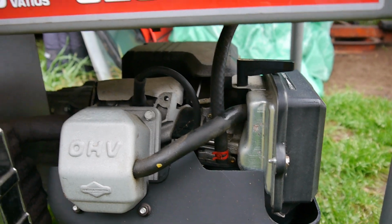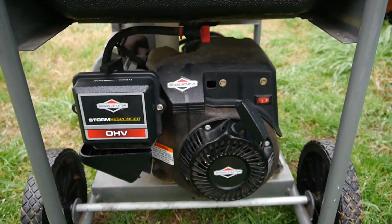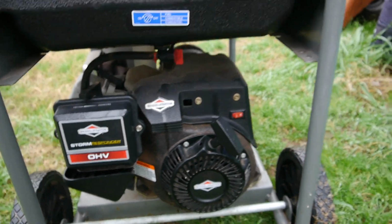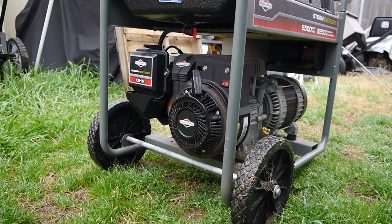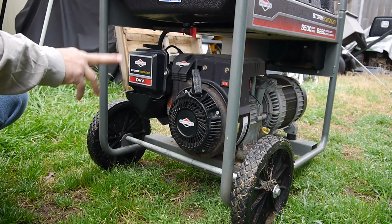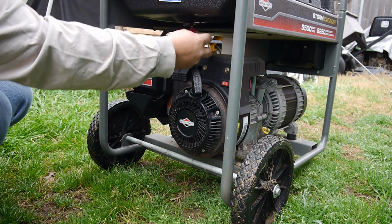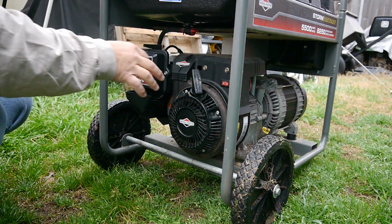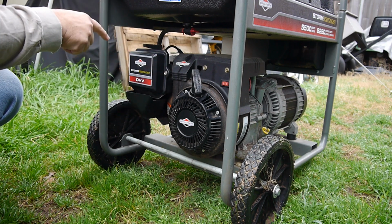So, but it looks in really good shape, right? So if it's a year old, maybe it just needs a carb cleaning. If that's not the problem, I mean, we'll just have to go through and troubleshoot this thing. If it's getting gas, I guess I can take all this off, spray some carb cleaner or whatever in there, and see if that'll prime it. Let's see, the gas was off. That's on. And if that doesn't work, if I spray some in there and it still doesn't want to crank, then I'll check for spark, right?